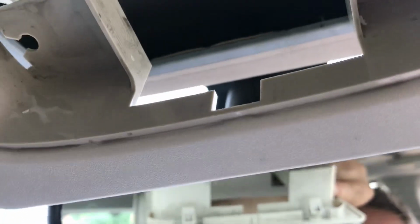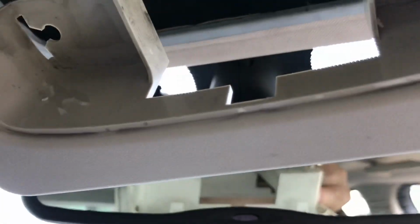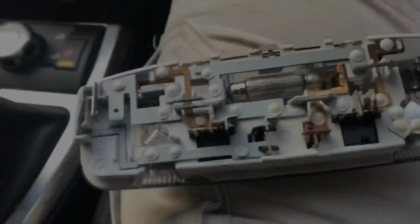So that spring is on the front. So as this panel is fitted up, you want to be putting a little soft table knife or something up where that little cutout is, at the front there, not at the back like I did earlier on. Doing it at the back works, but it's much easier to just pop something up the front to press that spring.